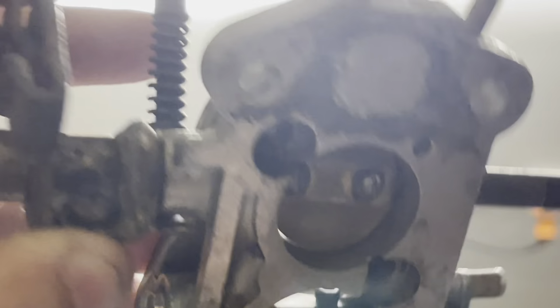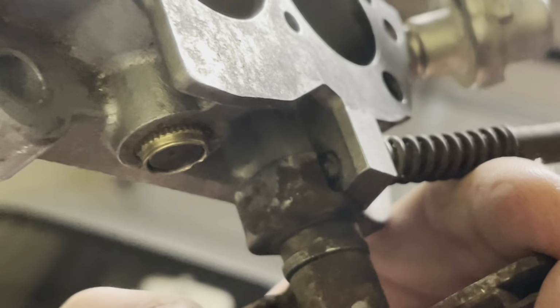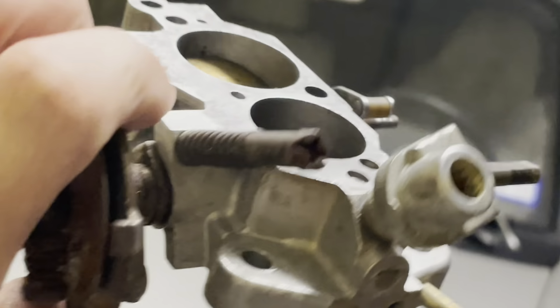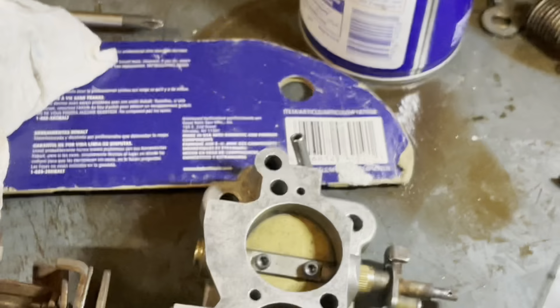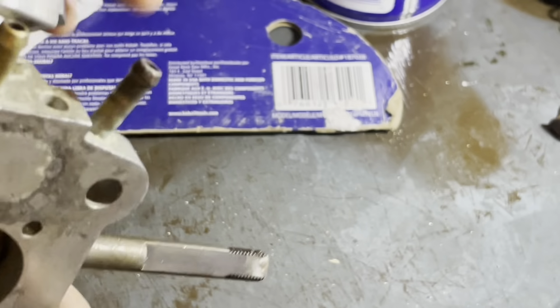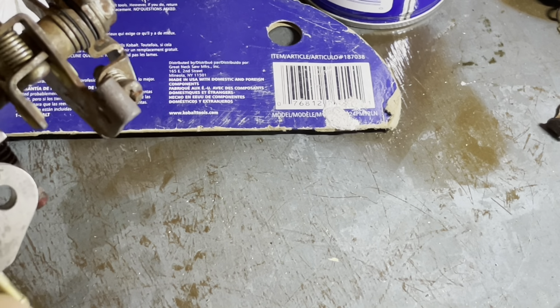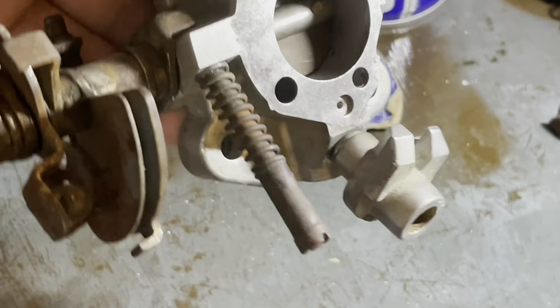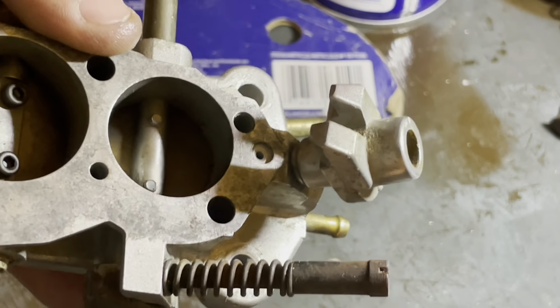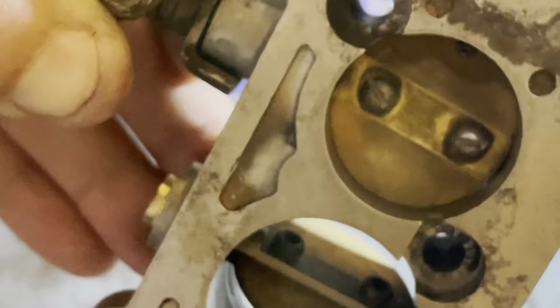So I suppose that's fine. That's just the idle screw holding the butterfly open. Actually, I want to be 100% sure. I'm gonna fully loosen the idle screw and close the plate all the way just to make sure that the screws are in the right spot. So I'm gonna just loosen these a tiny bit. Then I'm just gonna back out on the idle. Let's do it all the way. So there, it's fully closed. If it's fully closed, you know, force it shut. So now, if you're looking to do the light, there's a lot less coming through. So let's go ahead and tighten that.